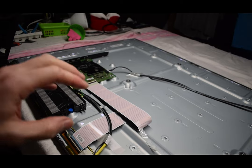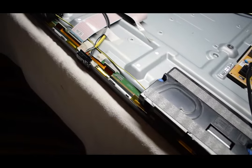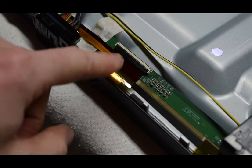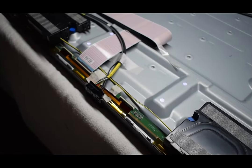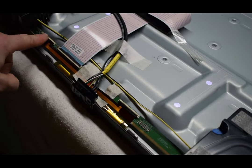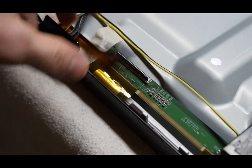The problem is with your LCD panel. The LCD panel has these little strips right here, and they have these little ribbon cables — hundreds of different wires that go to your LCD panel. Some of the LEDs on the panel are shorted, and that's why it does that. What you're going to do is: sometimes there's a ribbon cable that goes from the two panels — left and right. This comes from the main board. You're going to disconnect one of those ribbon cables, and that will disable half the screen.